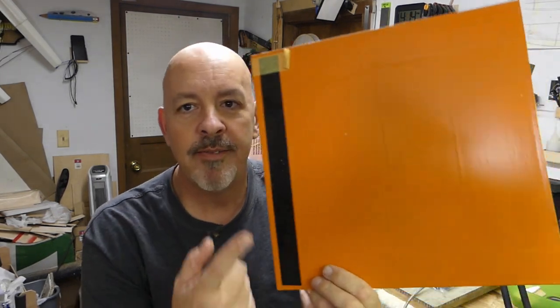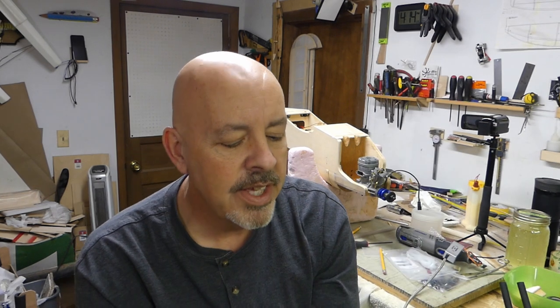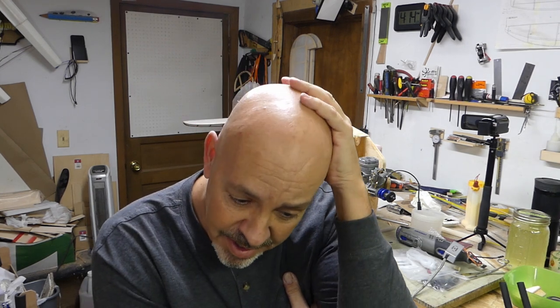The reason I'm changing what I'm doing is because of problems I had when I painted the big orange monster, affectionately known as Punkin — the big TaylorCraft. What I ended up using for the black striping on the side was Krylon Dual. I've used Krylon for years and I like it better than Rust-Oleum because it sets up a little bit quicker for handling, especially with the temperatures we have down here. Rust-Oleum takes too long for me to dry.